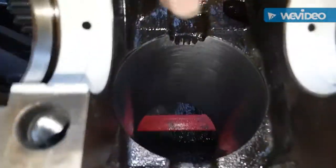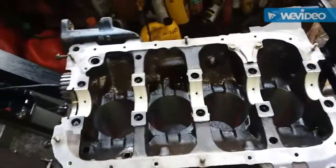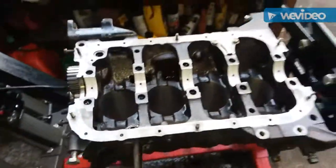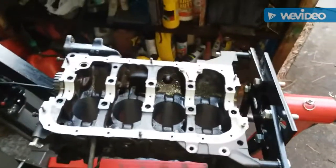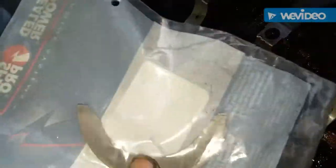I'm going to set the crankshaft in there. I know the crank probably should go to the machine shop and be balanced and all that, but I'm just going to send it. All the damage looks like it's right there, and if you do the B18 rods I heard this has to be ground out for clearance anyway. If it's a bad motor, whatever — I'll probably end up doing a swap soon. The thrust washers go in between cylinders two and three with the notches out.